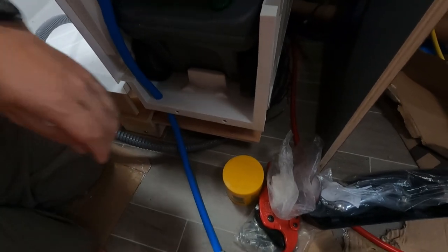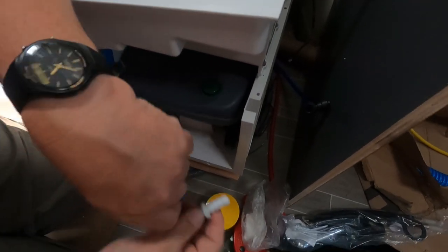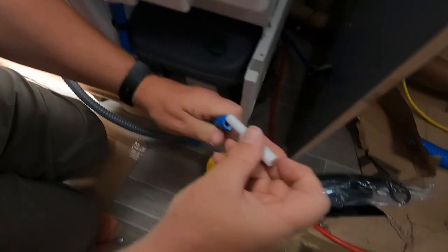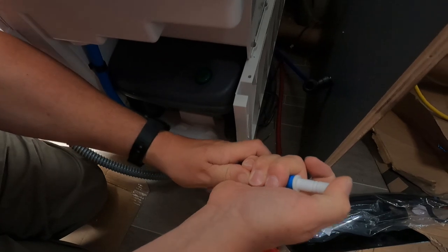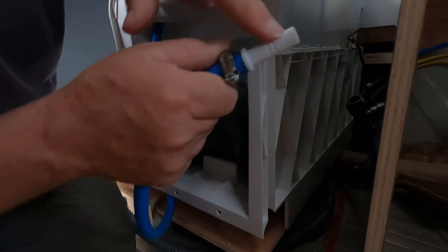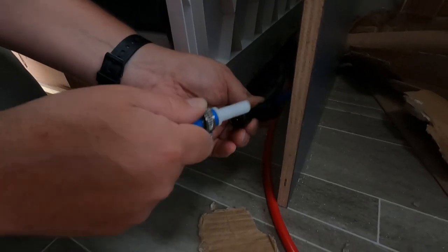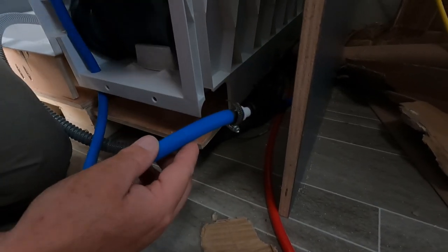Moving on to the water pipe: in behind here I've cut the blue pipe and put a T-piece in. From Magnum Motorhomes there's this little barbed fitting - only a few pence - that fits nicely into the barbed end, and I'll squeeze it in there with a jubilee clip. The other end is a 12mm push-fit, so the other end of my T-piece on the water feed pushes straight in there, and the top of the T-piece takes the water feed up to the sink.